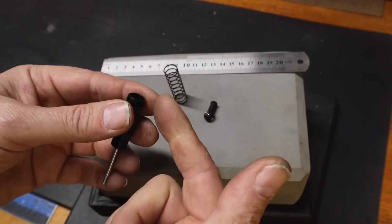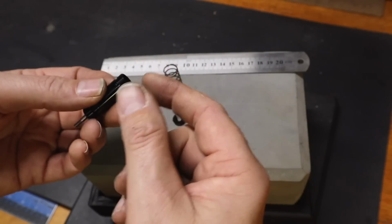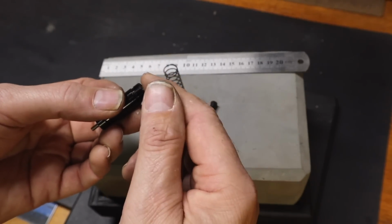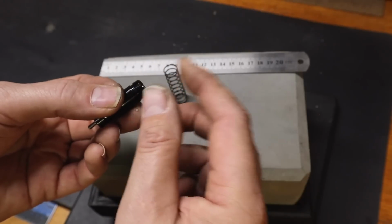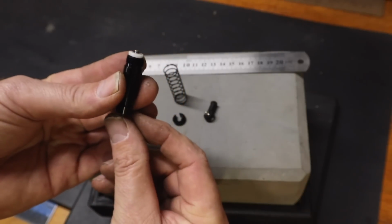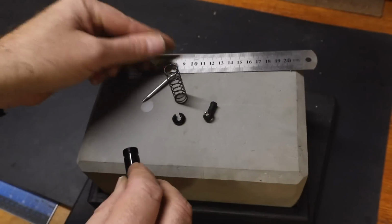Fill it up. Push this up to the top. We'll have the cap on about 2 threads. Push this to the top, which will be about there, which will put a little deflect on the piston. Don't push it up too high. I do it with the rod end fitted so that you can't do this. You don't want to do that. So we'll pop the piston out.